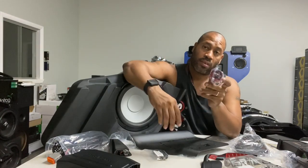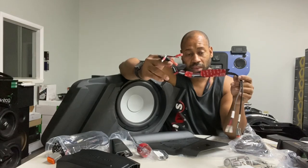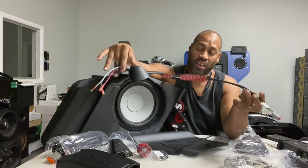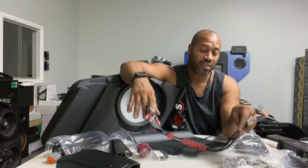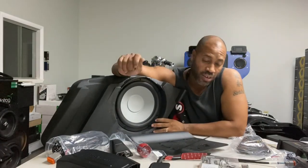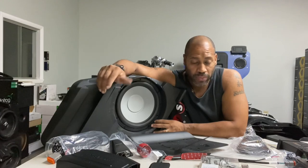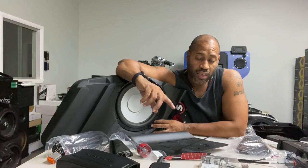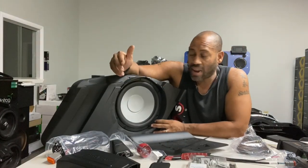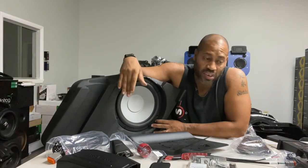They've included the two-inch hole saw you'll need for the plug mounts. This is the wire harness that connects to the subwoofer and the 6x9. It tapes itself to the bottom of the bag so when you insert the woofer or put stuff in the bag, it doesn't damage the cable. The kit also comes with new mounting hardware for the bags. If you have those half-turn clips, you'll need to remove them and convert to the included 5/16 bolts with flat heads. The turn-style knobs will not allow the enclosure to slide in, so you must use the included bolts — they sit completely flush, allowing the woofer to slide all the way into the bag.